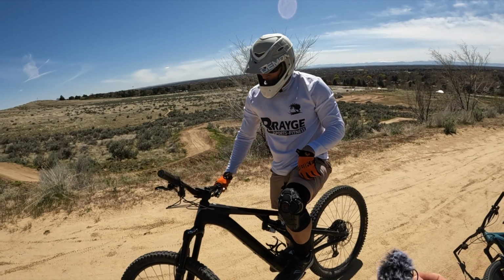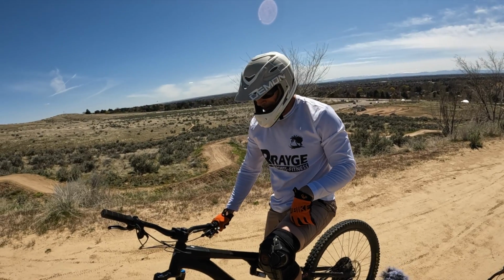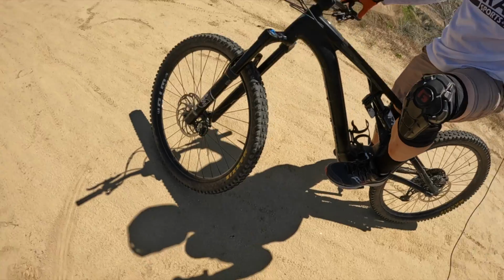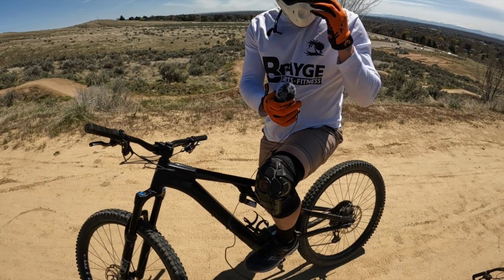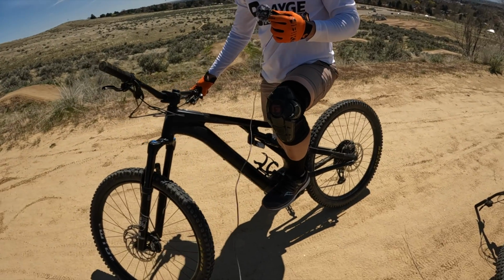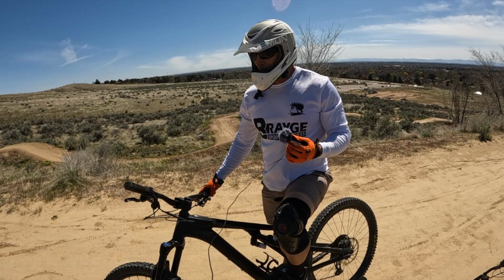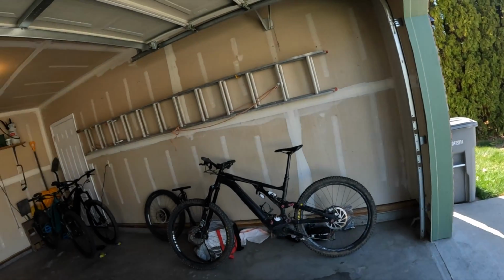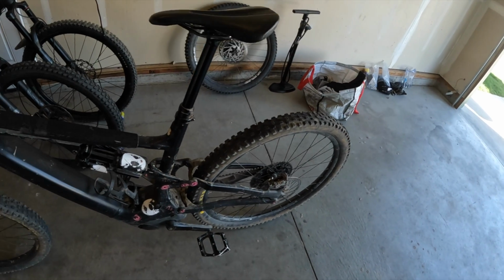My random stranger experiment interview did not go very well because it was crazy windy. He basically preferred the big bike because it's simply more powerful. Shortly thereafter, my random stranger experiment ended poorly. Basically, I told him about 800 times you need to spin a high cadence on the pedals. High cadence means you spin the pedals quickly when you're going uphill. If you don't do that, it basically breaks the motor. He locked my rear motor up, and that's a $1,200 fix.